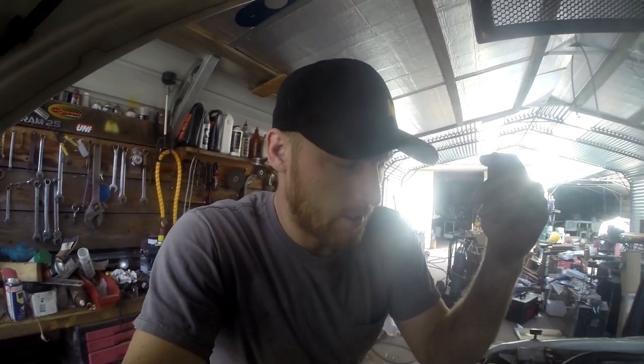It's running a FASS on it now, but it all comes down to common things that fail on these trucks. If you're looking to buy one, you should ask the owner if these have been addressed, and that is if the lift pump and/or the injection pump have been changed, preferably both. Because if your lift pump goes out, your injection pump can keep the truck running, sucking enough fuel on its own. Sounds good, it's not. It will ruin the injection pump.